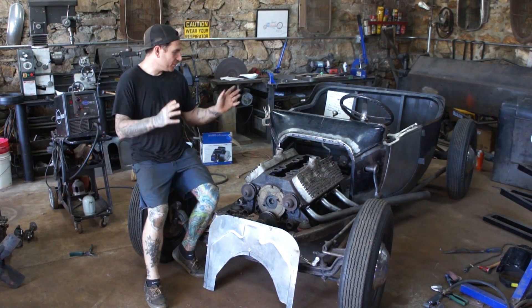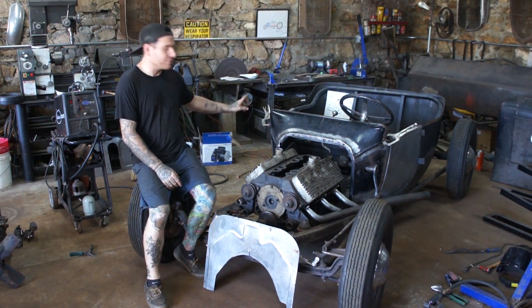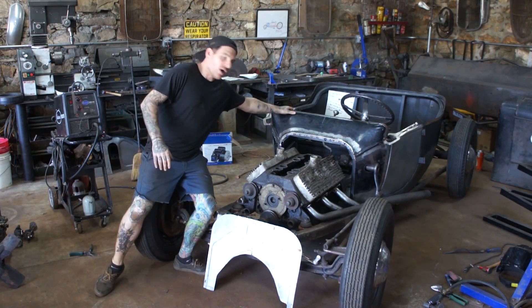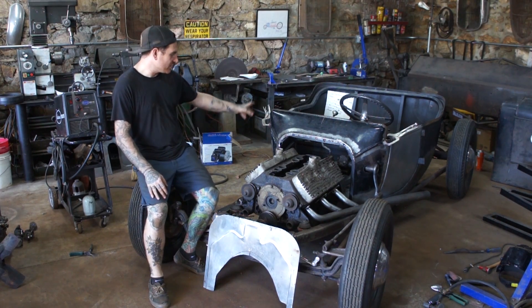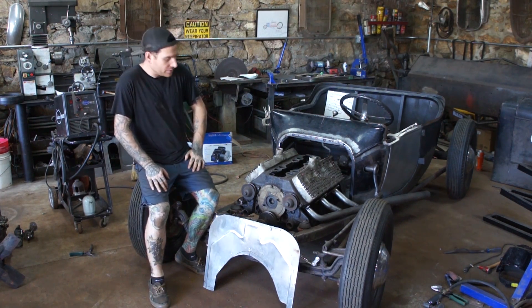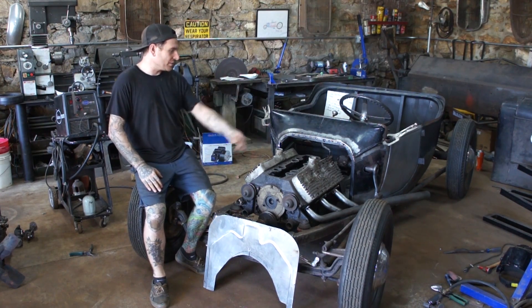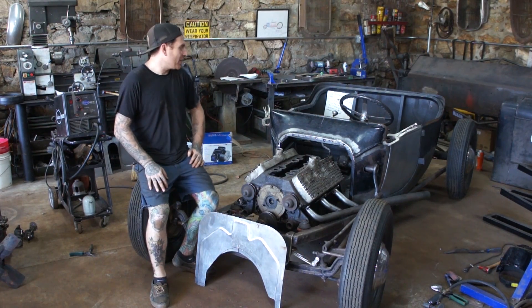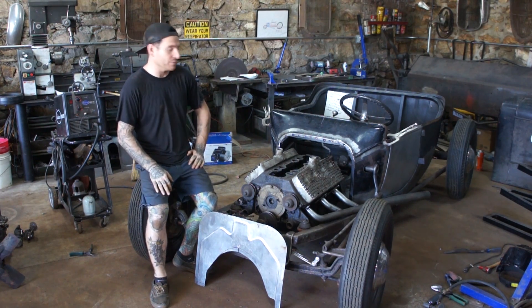So that was kind of the basic process of what we've got to do. We got to drill holes and spot weld them to the framework and fix the patch on the side. Good progress on this car — it is a lot more solid. You can start welding the sides of the cowl to the cowl sides here shortly. So we're moving along pretty good. This is just the tedious little work that we're doing. I'm going to keep working down the sides, and then we're going to get this firewall in next. We're just about ready to pull the body off of the frame once this stuff's spot welded, because then it'll be all sturdy and nothing's going to move or twist when we pull it off.